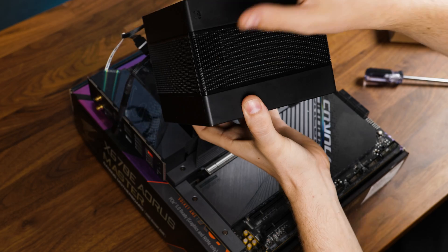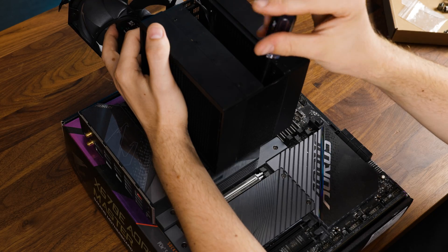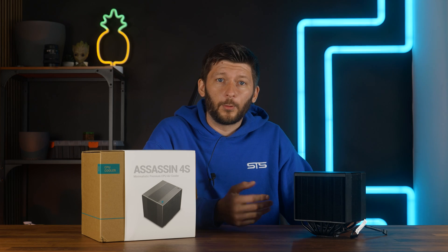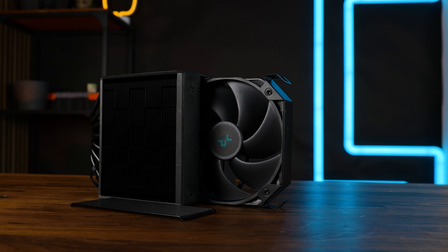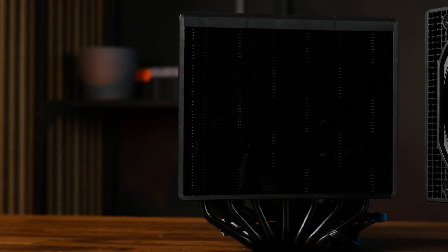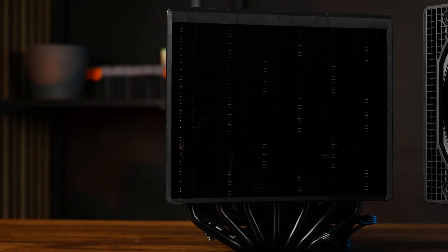From there, pop off the magnetic top cap, pull on the two levers to pull the fan out, install the cooler on top, and put everything back inside. In theory, you can install the cooler in both orientations, and because you can also turn the fan around, you can basically do whatever you want. But the actual orientation would be with these squares here towards the RAM, which would also give you 100% RAM compatibility because there is nothing touching the RAM sticks.